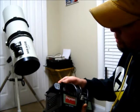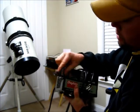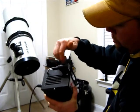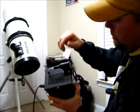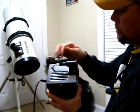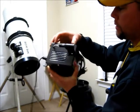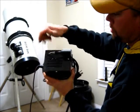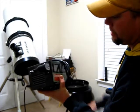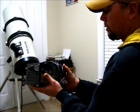One of the things I did do was I went to Walmart and just picked up a 12 volt power outlet, cigarette lighter, you can see, and it's got a nice little 4 bolt mount. I only got 3 of the holes right, so it'll work. It's on there, it's stable. Just simply drilled a hole in the side of the battery case, took the battery case off here, drilled a hole in there to run the wire in, drilled the holes here to mount it, and bought a 98-cent pack of screws and nuts to mount it up here on my battery charger.